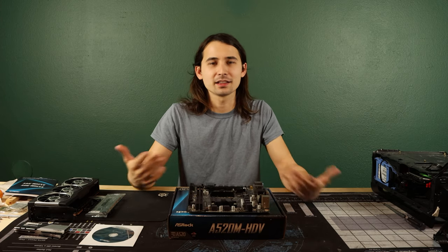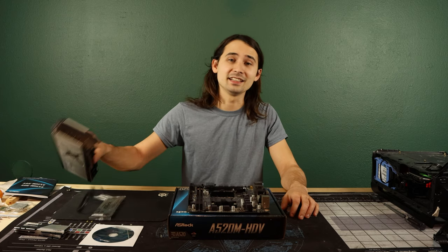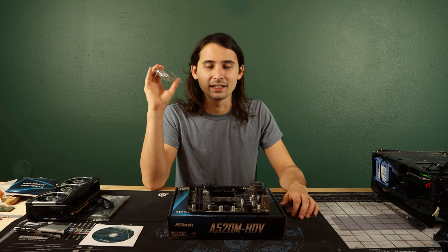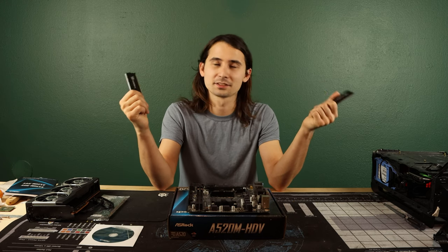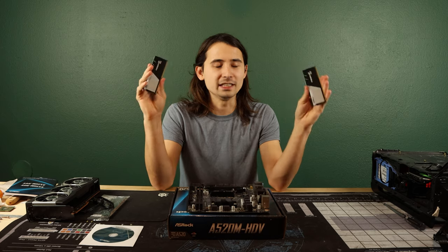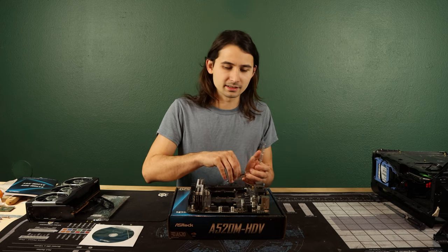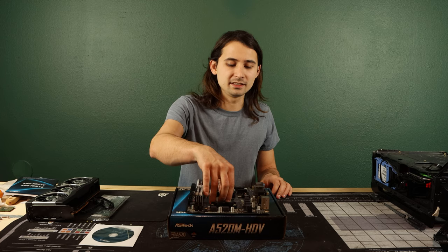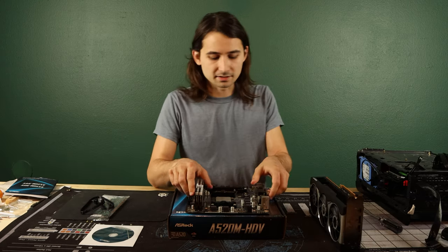You're probably thinking: okay, all that's great, but how does it perform? That's why we have a 6900 XT sitting here. Today we're going to run it with a 6900 XT and a 5800X in Rage Mode to show that gaming performance is largely unaffected by the motherboard you're using. We also have 16 gigabytes of Trident Z Neo RAM at 3,800 MHz CL14 — some of the fastest RAM you can buy — which costs four times as much as this motherboard. And here we have the Ryzen 7 5800X, an eight-core 16-thread processor capable of boosting to around 4.8 GHz. Keep in mind it has PCIe 4.0, but this motherboard does not — so we'll see how that affects the 6900 XT.